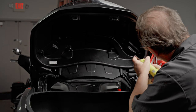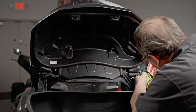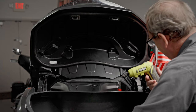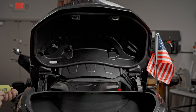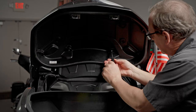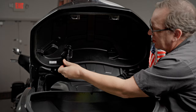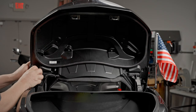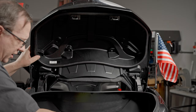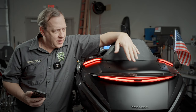When replacing all these screws, do it slowly — loosely get them in first, then go around and tighten them all up at the end. Don't forget the ones on the side. Go around and snug them up, making sure they're all seated the way they're supposed to be. Sometimes you need to tap the seat to make sure it's seated. It pays to take your time during this part so you don't strip out any of these screws. Just fold that down and you're good.